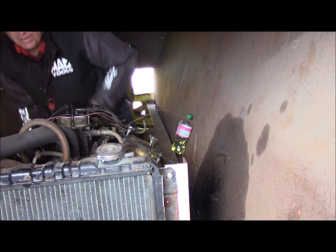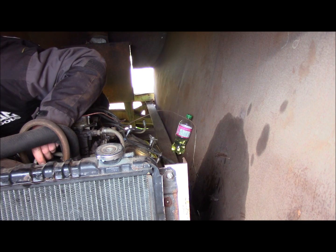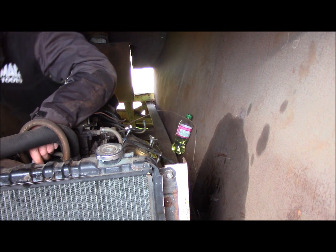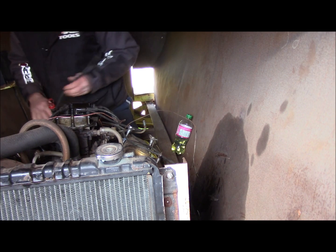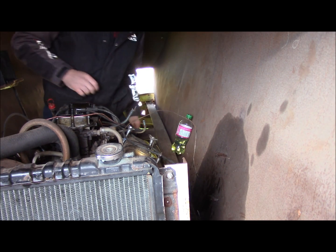So I don't know if you can see me or not, but we're not pumping fuel right here, so there is a problem with the fuel pump. Either it needs a fuel pump or it's not going to siphon down there. Who knows? I think we'll go ahead and order a fuel pump for it. Let's take the cable end off. Let me get out here and we'll have a little talk. Or grab the camera and we'll have a little talk in here.